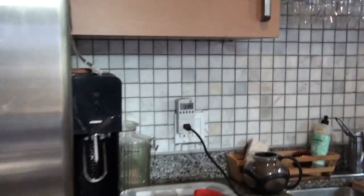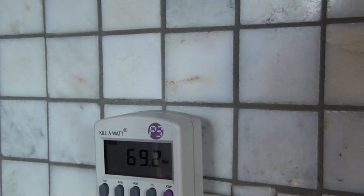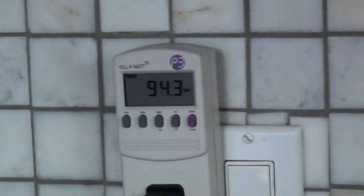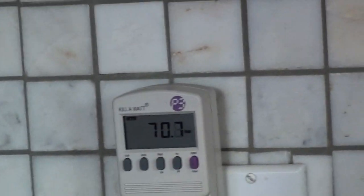Just to verify how many watts it now pulls on high — actually it's not that bad — it's about 70 watts on high. I think what I had seen earlier was when it first turns on it pulls about 100 watts to spin up, but then it gets to a steady state of about 70 watts on high.